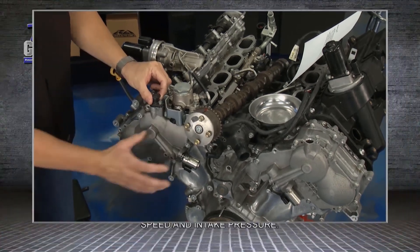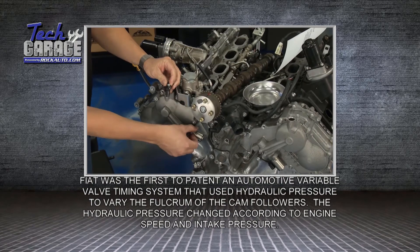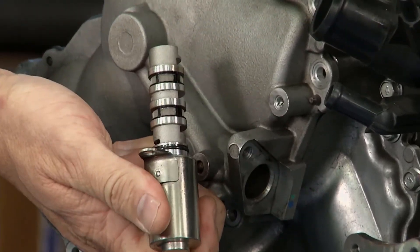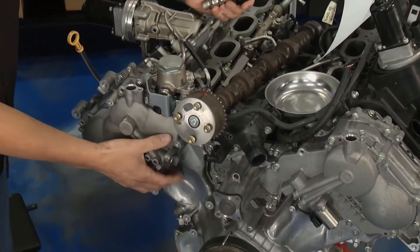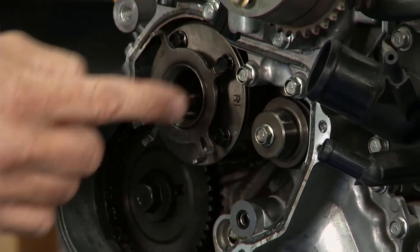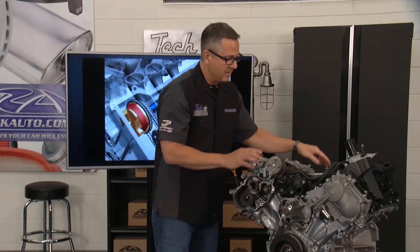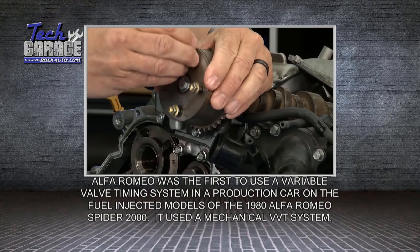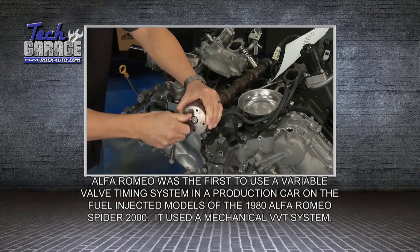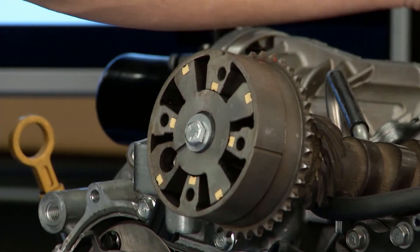Here it is on our engine right here. If you look at the front of the engine, you have a variable valve timing system. You have a camshaft position sensor that knows where the camshaft is located — that's right here. And then Brian was checking out this actual solenoid right here. The solenoid allows that oil to inject into the system. Those two components allow this phasor to move back and forth — it's watching it, looking at these positions where it's at, moving back and forth with oil injection through the cover and through the center, moving that camshaft. It also helps with EGR — exhaust gas recirculation — keeping some of that in cylinder by affecting the timing and lowering those temperatures.